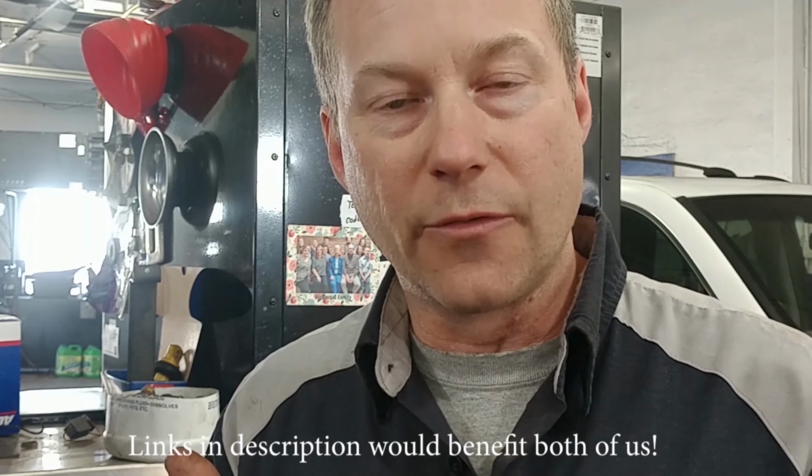2015 Toyota 4Runner. Rear brake pad replacement. You want to break the lug nuts loose, either 19 or 21. These are actually aftermarket wheels with specialty rims, so 19 or 21 millimeter. All bolts will be left to loosen, right to tighten. So break them loose on the ground, a turn or two, probably with a half-inch breaker bar and an appropriate lug nut socket. And after it's broken loose a turn or two, jack up the vehicle.